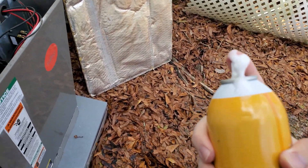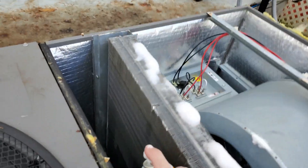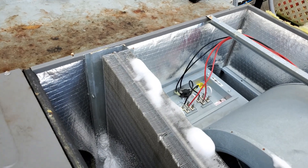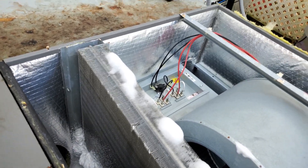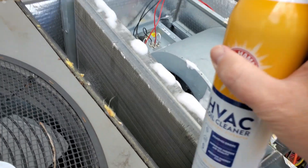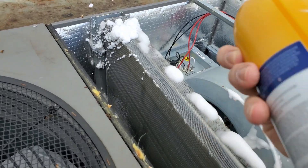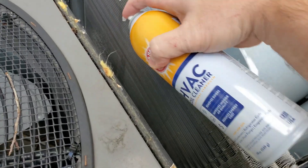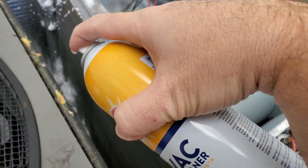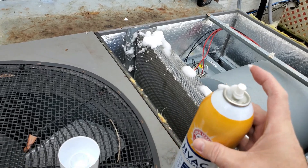I'm going to try to record while I spray this a little bit. As I shake it, there's no agitator ball — the can seems to be completely under pressure. It's best if you start at the bottom. I found after doing the other side it just seems to work better that way. Once it starts making that airy sound, you need to spray at the top to get the air out of the line and it goes back to spraying well again. If you spray holding the can upright it'll spray all day, but if you invert it you'll start getting air in it and it'll want to stop. Just alternate back and forth as you hear that airy sound coming out of the can.